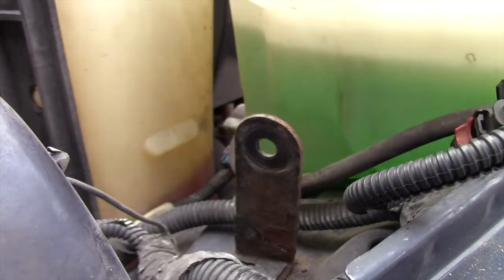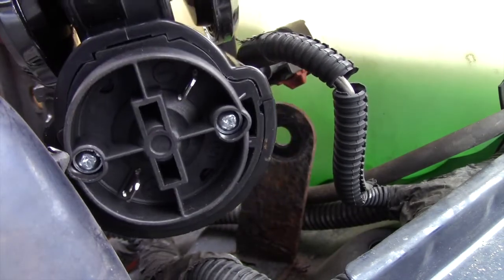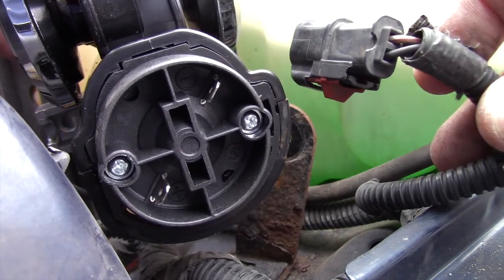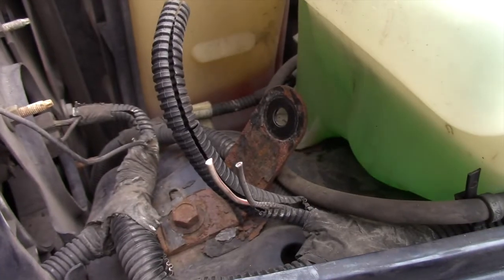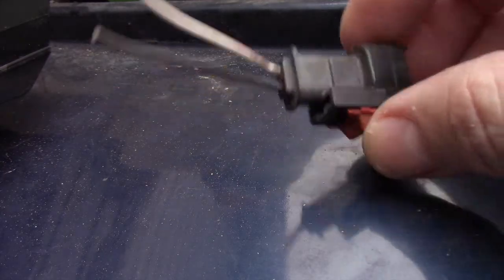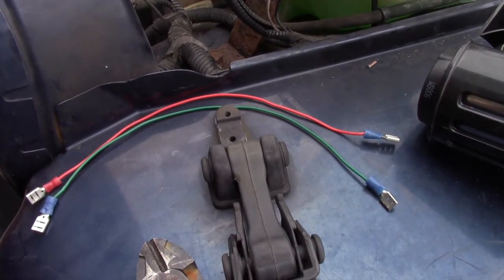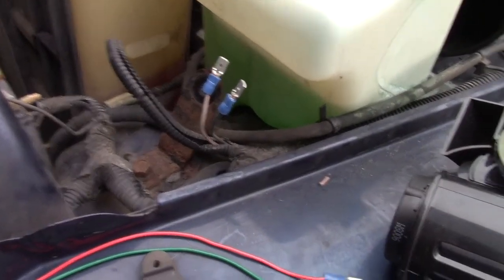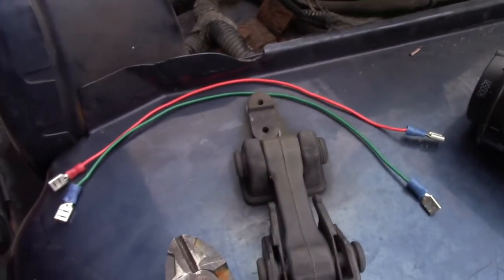We can discard this now. Since this horn is not a plug-and-play device, what we're going to need to do is cut our old plug wire here, create a couple little jumper wires, and just do a little wiring magic. I just cut off the old plug, but I left myself just enough pigtail wire in case I need it in the future. Here's my entire wiring setup: I created two little jumper wires with spade connectors, put some spade connectors on the existing wires, and everything should slip directly onto the new horn perfectly.